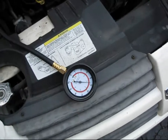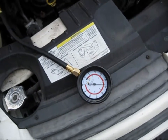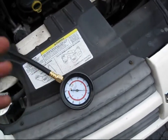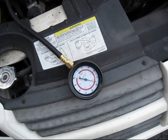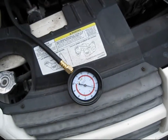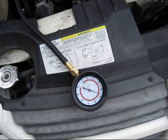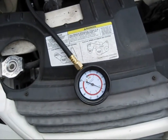From the beginning of the video I was running at about 28 to 30 psi, which is way too low. This pump will probably run even higher once the alternator is running and putting out just over 14 volts. I'm feeling pretty confident that my code P0171 will be gone with this new American fuel pump.